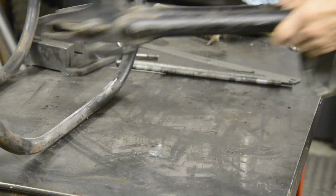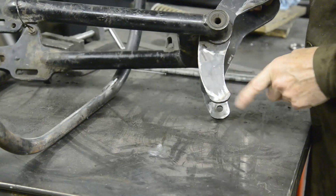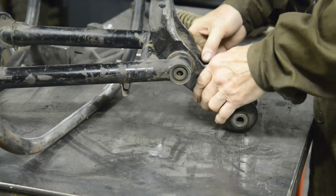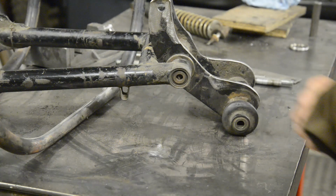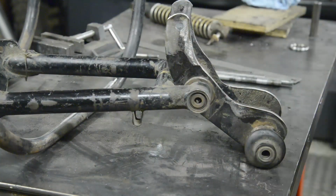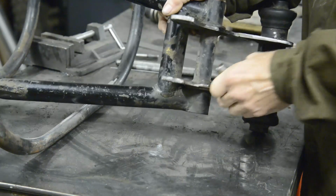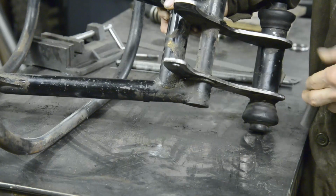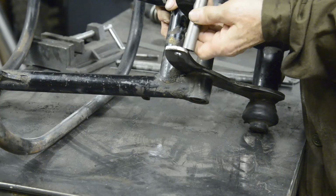Alright. Make sure you're still in view. Yes. Now then, what I've done is I've cut these plates now so they all fit properly, and I've drilled a 1/2 inch hole in one side. There it is. I've also made up my spacing piece to go in here, because as I say, I want to strengthen this. There's already one piece there, one piece there, so this nicely makes the whole thing more rigid. So this is a nice tight fit in there.